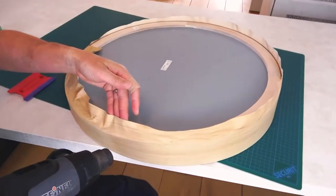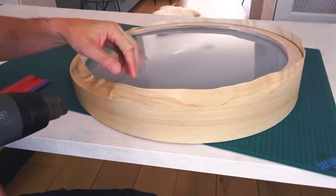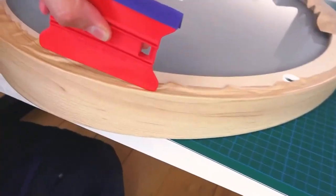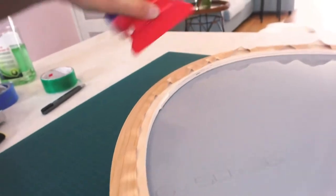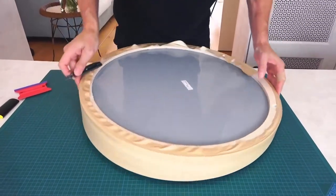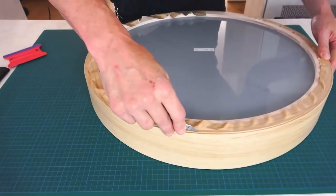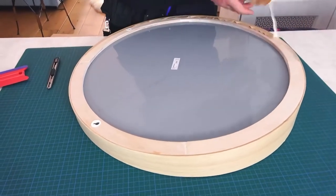Once the outside edge is sealed, it's time to focus on the back. Here, use the natural shrink of the film — simply add heat and it will conform to the back edge without having to squeegee or pull. This is called zero stretch. Tuck the film into the outside edge with the hard side of the squeegee, then cut the film safely away with the tip of the stainless steel blade right in the groove. Rotating the mirror so the cutting position is comfortable is critical to avoid any mistakes. Once the excess film has been cut away, remove it safely by pulling towards the inside.